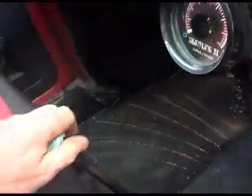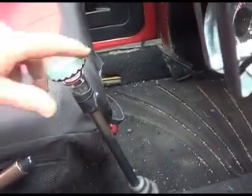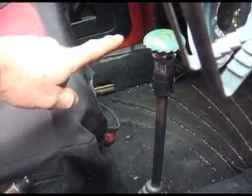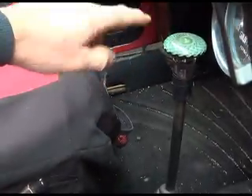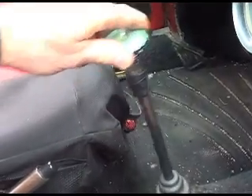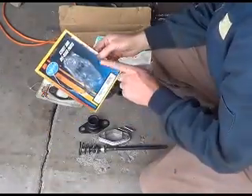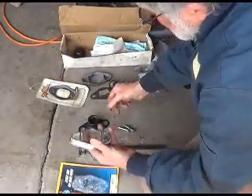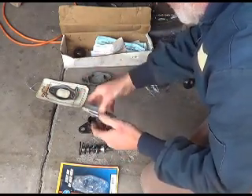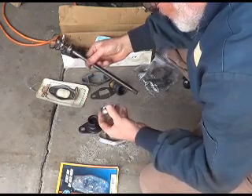Now what I want to do is shorten the throw. So from the edge of the cup holder we're looking at the door frame and then going back this way — that's the distance we're going to shorten. This was another MP product, a spacer plate that raises it up. If that is aluminum it almost feels like plastic, and this piece feels like nothing as well — there's your old pop cans for sure.